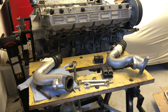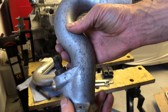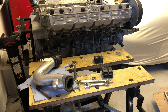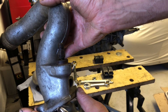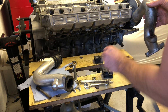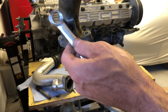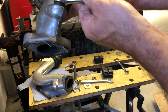Here's what it looks like before you start. You can see it's sort of tight in - it's very hard to see what you're supposed to do with it. So this is one here that I've just started, and you can see it's started to pull out. What I do is I use a combination of spanners that are sort of big enough to go over the injector completely and sit down onto that seat - sit down like that.